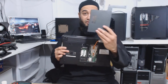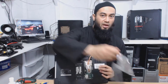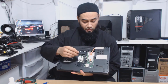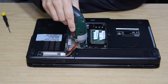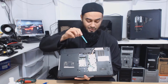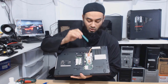The method. First, to remove the back cover, it was held by four screws. Just undo them one, two, three, and four, and while you're there, clean off the back cover from any dust. Next, you're going to have to remove the cooler, which is held by five screws. Once you undo them, it will easily come off. If you're having any resistance, use the flat plastic spudger and insert it between the cooler and the CPU and try to pry it open, but don't apply too much force — hopefully it should come off.